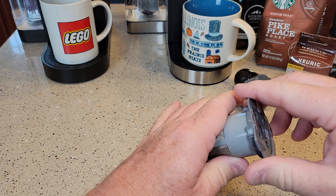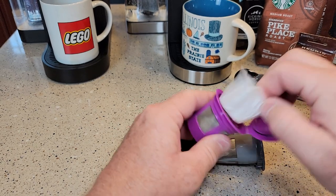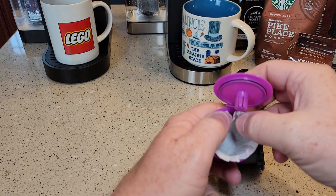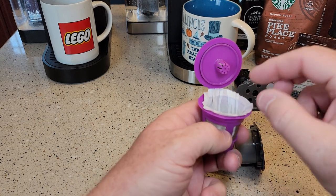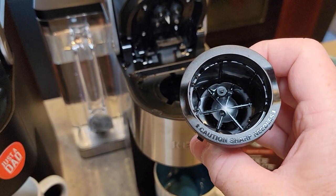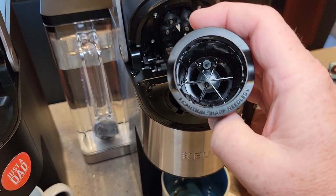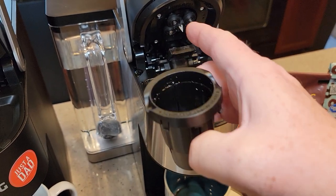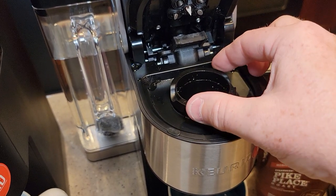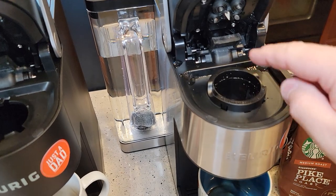I haven't found a paper filter that fits down in this new five-needle reusable K-Cup. For the standard single-needle reusable K-Cups they do sell little paper filters that fit inside and prevent sediment, but we can't use that type on this machine. When you're done using the reusable filter, make sure you put the needle basket back in. There are two small tangs and one big one — make sure you can read the words 'caution sharp needles,' with the needle pointing up toward the machine. Make sure it sits nice and flush, and when you close the handle don't force it, otherwise you can break something.